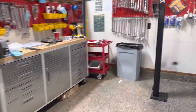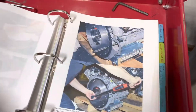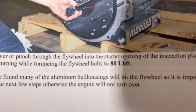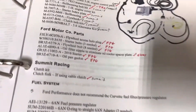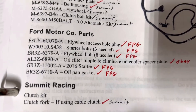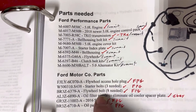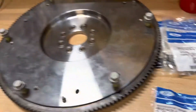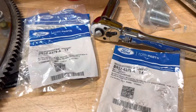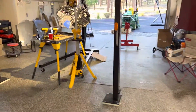The book says torque them to 80 foot-pounds, and that's exactly what I did. I did buy the exact bolts as mentioned — here's the manual with the instructions: 80 foot-pounds. These are the exact bolts and the exact flywheel they recommended, so I'm certain I had exactly the right parts. I got them from a Ford dealer online — brand-new flywheel bolts.